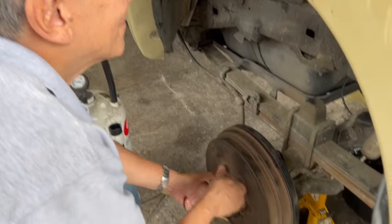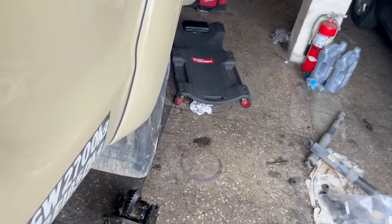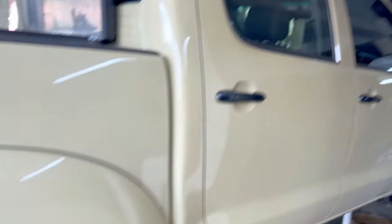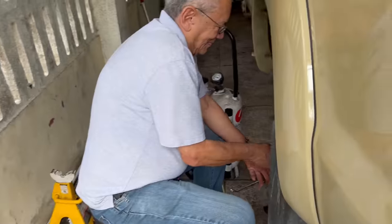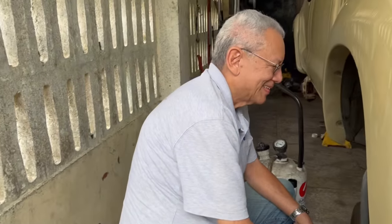All right, so I have Mr. David on the wheel here. He's spinning the wheel forward. With an open diff, if you spin the wheel forward, naturally the other side will spin in the opposite direction. All right, ignition on — air compressor first, then rear locker. So if I come back over to Mr. David, he's spinning the wheel forward and this wheel is also spinning forward. It's fully locked. Any thoughts, Mr. David? It's fully wonky now. Fully wonky — it just got the full treatment.